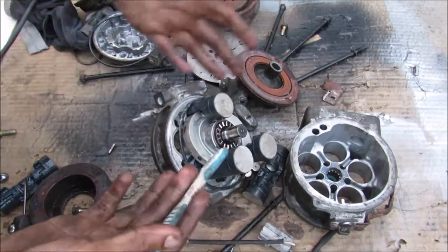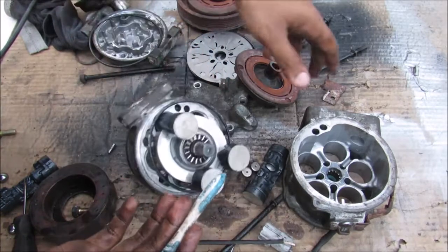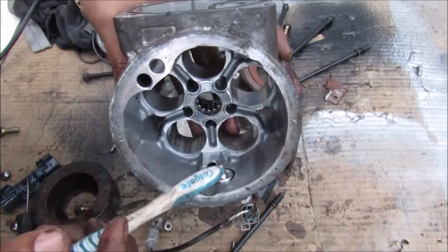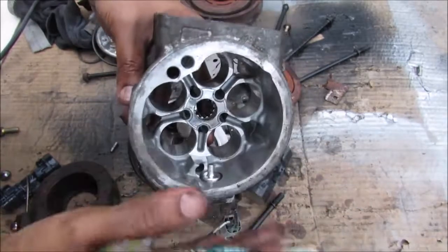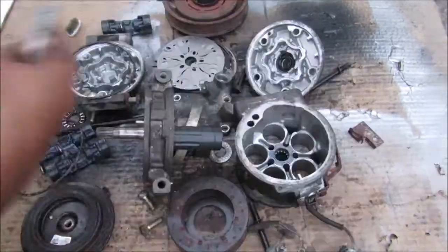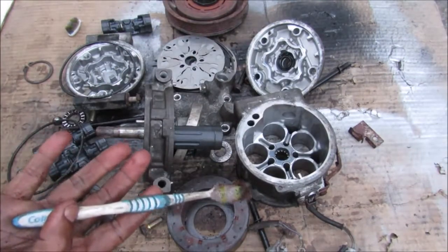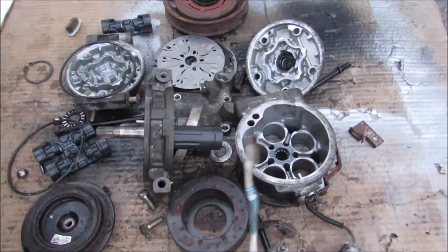It's a good idea in wintertime to engage your AC compressor for a couple of minutes just to make sure everything is working properly. Some AC compressors have a built-in sensor to detect if the amount of refrigerant in the system is too low, and it won't allow the AC clutch to engage just to save the compressor and the rest of the system. And that's pretty much all the components inside your AC compressor that allow you to cool your car — make sure you subscribe if you want to see more videos like this one.